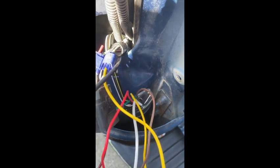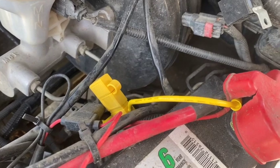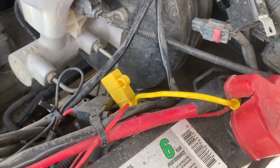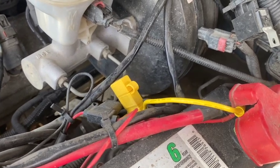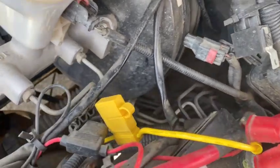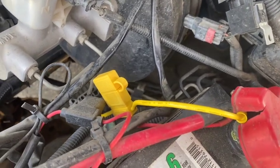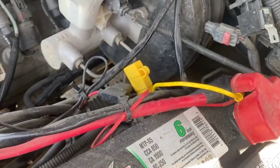All buttoned up. They supplied one fuse with it, but I would strongly recommend spending a little bit extra and getting their wiring kit — it's pretty slick, all the right sizes. For anybody doing it themselves, they installed a 15-amp fuse on that 12-gauge power wire.